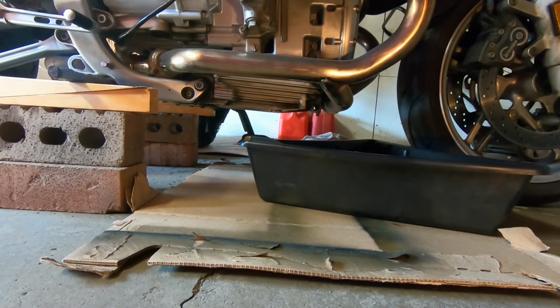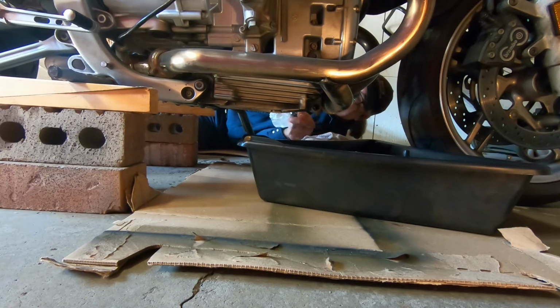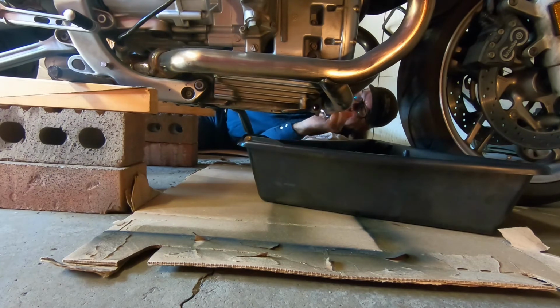And you really don't want to over torque anything on this particular motorcycle engine, because the crankcase on it, the block and everything on it, it's all aluminum. There's nothing steel about it other than the pistons and the crankshaft. You don't want to be over torquing it. Once you strip an aluminum head or block, anything aluminum, oh no, it gets to be a big trouble.